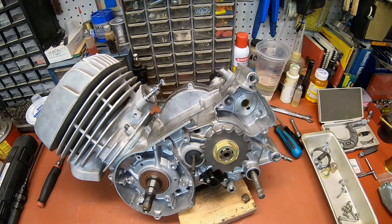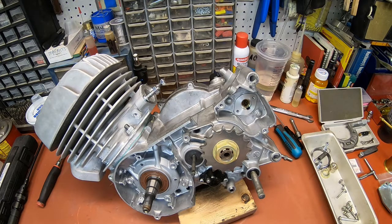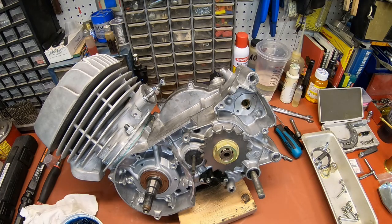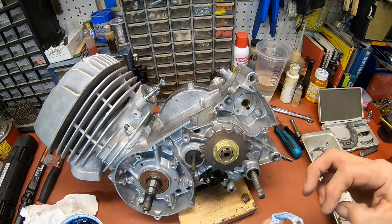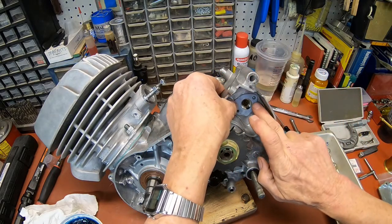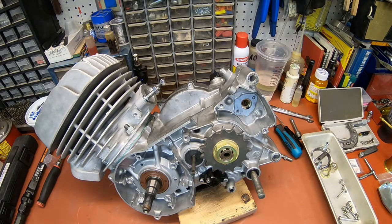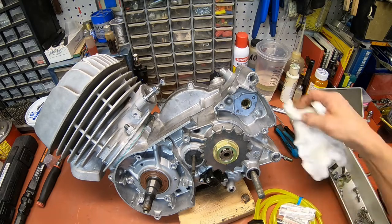And now let's get our oil pump. Make sure that gasket surface is clean. And our gasket. I'm just going to put a little, let's see, I think it'll go either way. Just a little grease on it to hold it in place. Just like that. If you've ever scraped a gasket off in there, you know not to put gasket sealer on it. Just not necessary there. Check the mating surface here.